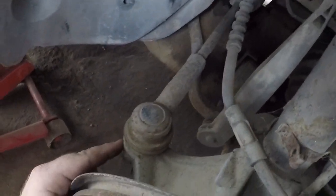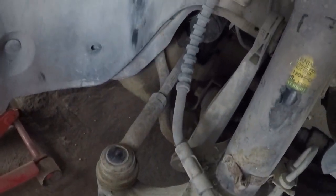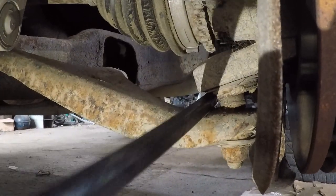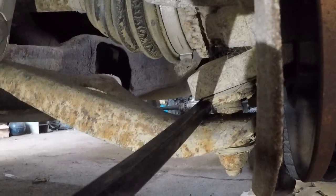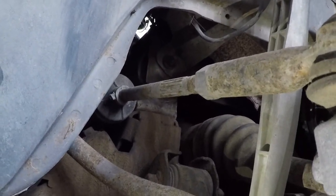There's no play in the tie rod. There's definitely some play in the steering rack. Oh god. That's a different problem altogether. Yep. Have a look at the ball joint, boys. Also bad. So till now it's lower ball joint and maybe inner tie rod end or the steering rack. I'm not sure yet. On the bright side, it's got brand new brake pads.